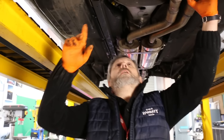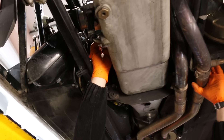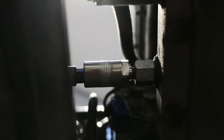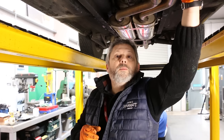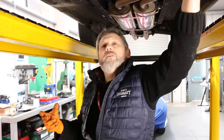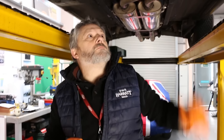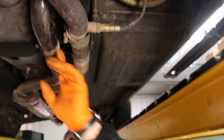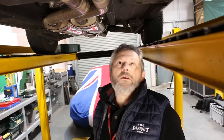While we're rolling around under the car, I'll just point out another couple of sensors that we need. Just here, screwed into the oil gallery, is another sensor that detects oil pressure. That stops the engine starting until you have good oil pressure, and it also means that if you lose oil pressure when you're running, it'll kill the ignition and your car will stop, hopefully preventing damage. We also have a pair of oxygen sensors — one in each manifold — and these are sensing the exhaust gas flow and adjusting the ratio to suit.